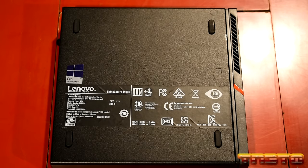And there is some thermal compound from the previous application, because this is a used CPU, you know, it was a pull, right? So I will clean up that CPU and also clean up the surface. I'll clean up the CPU that I pulled out as well, and we'll put that in an anti-static bag to store it away in storage. But I'll go ahead and clean up this more, and then we'll put the lid back on, and then we can put the heatsink back on, which will be a lot of fun, right?